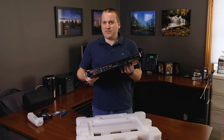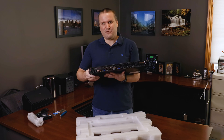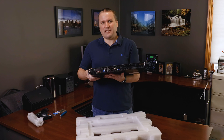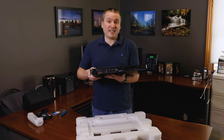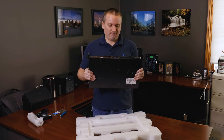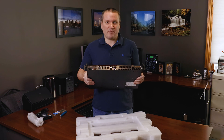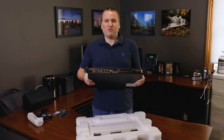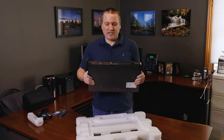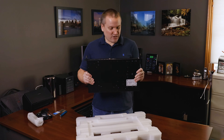While I don't have an external 10 gigabit connection — which I would love to have — I don't need to do full routing at 10 gig. But when transmitting packets between VLANs, I would like to be able to do that at a decent line rate. I have a MikroTik switch that will let me do inter-VLAN routing, but I kind of wanted to do that on real router hardware. That's why I chose this one.